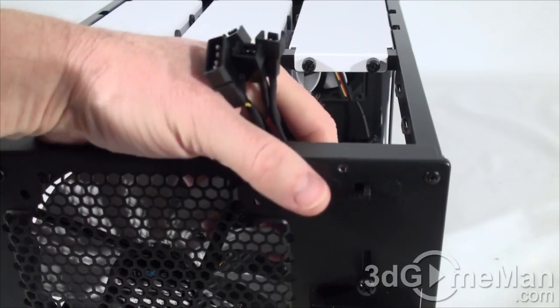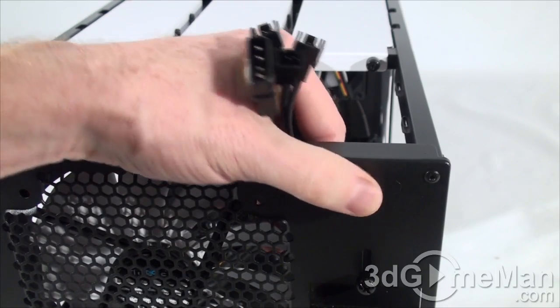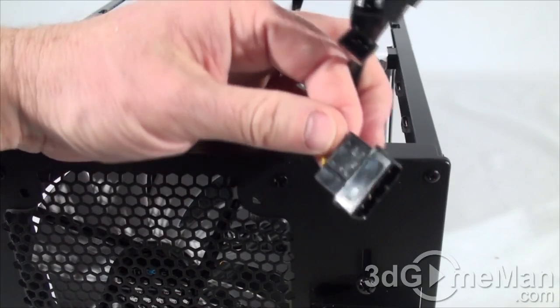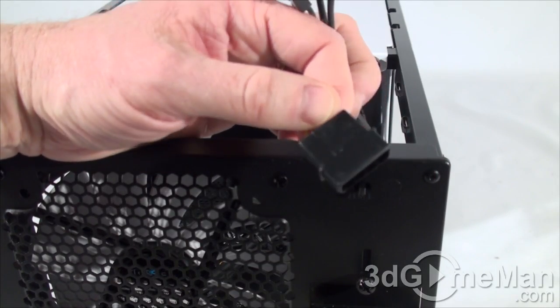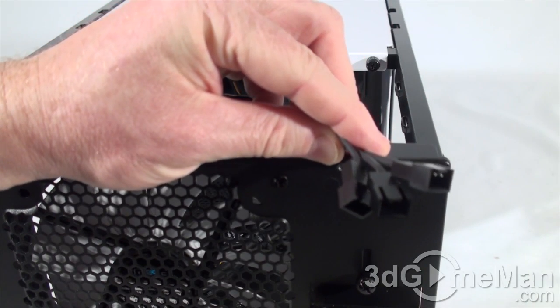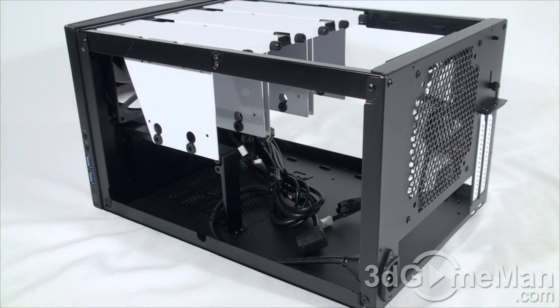Now also at the back, they have this fan speed control. You've got a low, medium, and high setting, and these are the internals for it. This would get connected into the power supply's 4-pin Molex connector, and then you've got these leads which go connected into 3 fans. Now this case fits mini-ITX and DTX form factor motherboards.